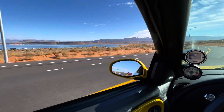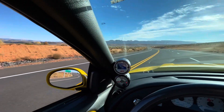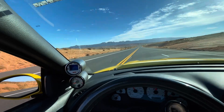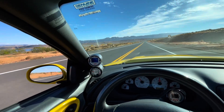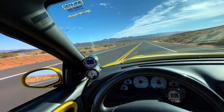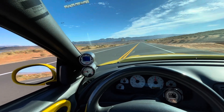Simply put, the V6 Mustangs had a pushrod engine, which was a 3.8 liter, or in 2004 only a 3.9 liter. It had a single cam that goes down the middle of the block, where the GT and the Cobra had the overhead cam engines from 1999 to 2004. So you had either a single overhead cam, which meant you had one camshaft on each side of the engine, on each cylinder head, which was on top.